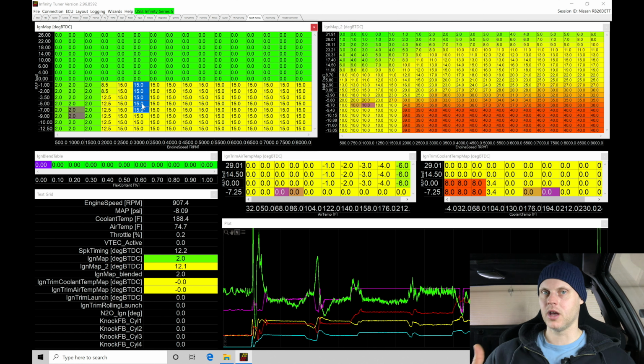Once they fix and regulate themselves at that speed, they'll be constantly backing off the throttle to a certain point as you add timing in. Once they're not pulling their foot off the throttle any further, there you have reached maximum brake torque, because the torque production isn't increasing. You'll find that the vehicle's speed will just flatline. It won't go any faster because there's no more torque output. It's the same idea as I'm accomplishing with the chassis dyno. This is just easier on a chassis dyno and it's in a controlled environment.